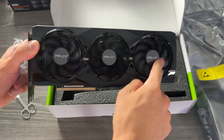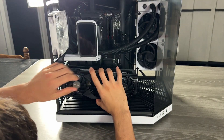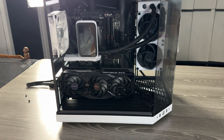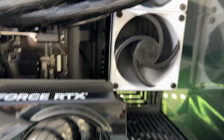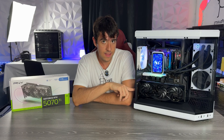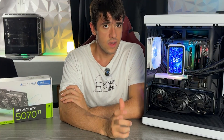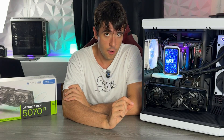The card is also pretty thin, but has a triple slot IO shield, which is a very big negative because it means you cannot put it in any SFF PC. And also if you're vertical mounting it, you need a triple slot space — it's a massive issue. I wasn't expecting them to do this because all modern cards are cutting into two slots. The third slot does nothing, but they do it to have air come out, and with a triple slot you do get a little bit more stability. So it makes sense in that regard, but this is a big negative from me.